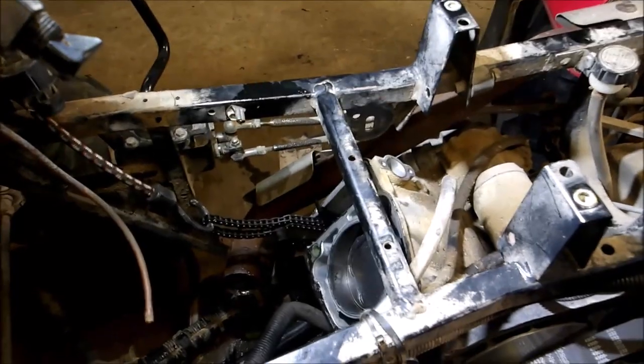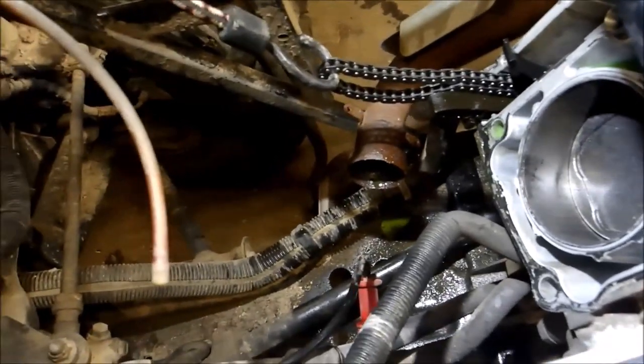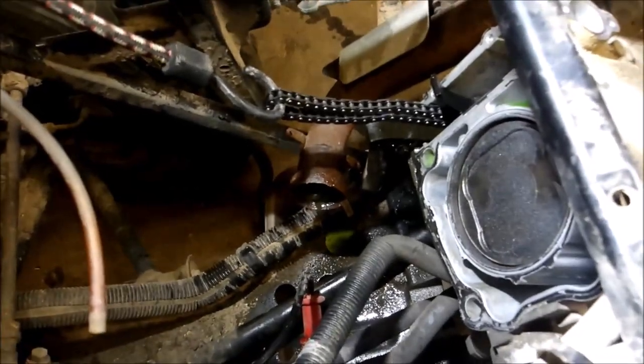So I'm going to show you what I got going on here. If I grab the clutch, watch the piston — it stops. There's nothing there. If I pull all the way up, it stops. The piston actually moves. So that tells me the piston skirts are probably burnt off.